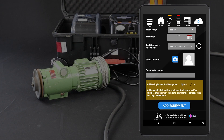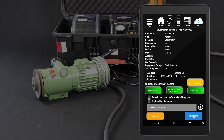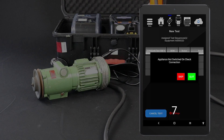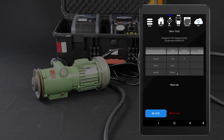You should now be viewing your new item's details. You can also view the details of an existing item by scanning the barcode on the item's tag or searching for the unique barcode. When you are ready, tap Start Test to proceed. Conduct the visual inspection and select the appropriate result. The test will only proceed if the device under test passes the visual inspection. If your appliance does not have a power button or switch, you may need to override the connection check.